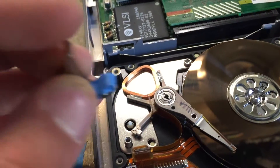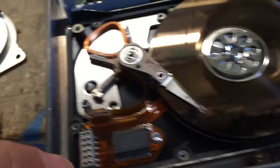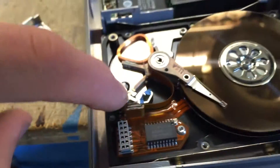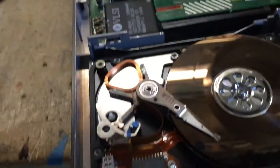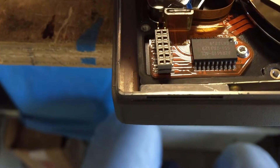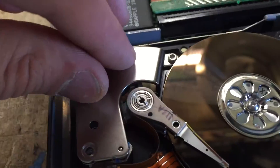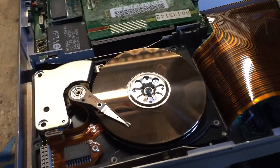I applied some tape on this end and also reinstalled the gasket, making sure the holes are aligned with the various screw holes. I can now reinstall the little stop end and reinstall the magnet — preferably the correct way in since I always seem to get this wrong. And now I can screw the entire drive back together and hopefully it will start working again.